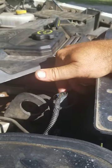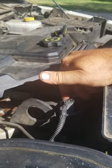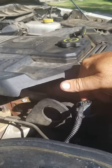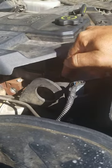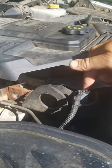What I did was I took it off. I checked it with a straight edge — it was warped. I put it on a belt sander and sanded it as best I could to get a flat surface with a straight edge. When I went back in, I put a new thermostat, a new gasket, and the bolts. It's got these small little 8mm bolts, three across here, none on this side.